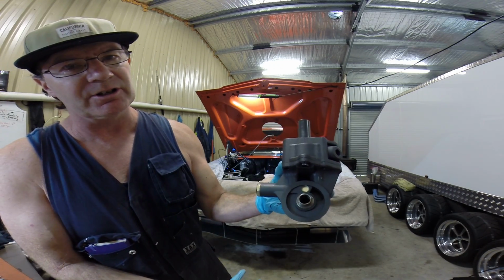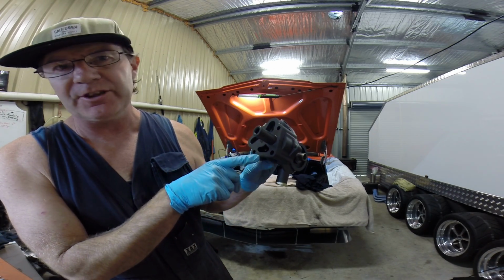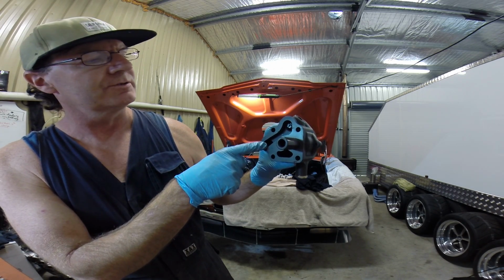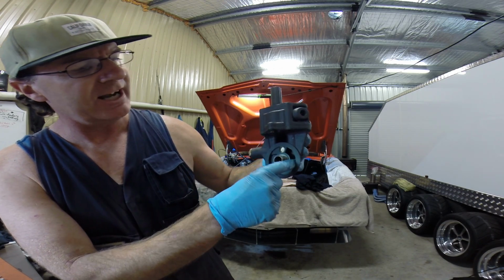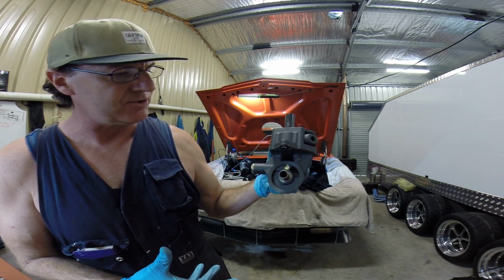And that's the secret, guys, is getting that flow. The gears will pump like crazy. They'll shift the oil that's needed. The restriction is all in the size of the hole. So on that first mod, I ground all the surfaces around the bends and tried to do a lot of blending, and that's what TK sort of done.